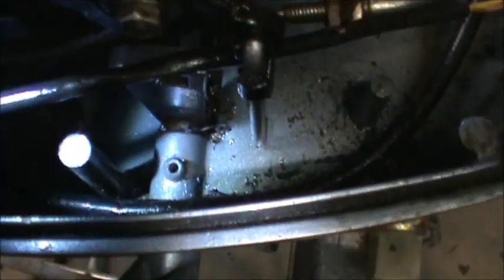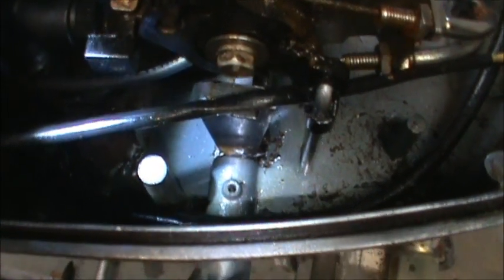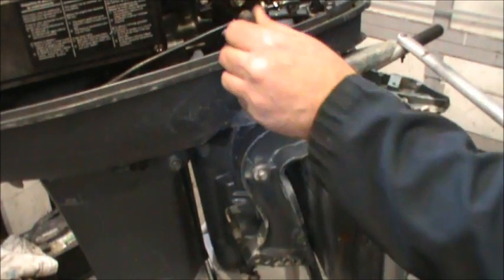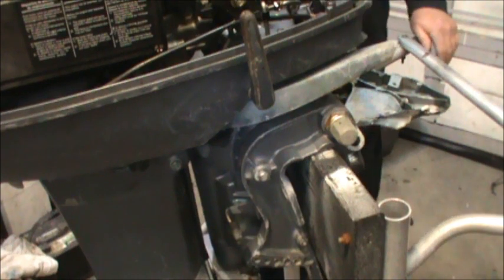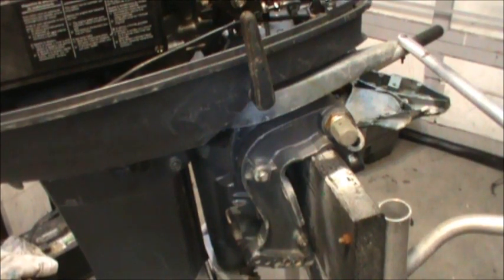You can see there's an oil zert there. I drilled that out as best I could and shot some fluid in there. I don't think I can heat anything in here because I do believe the shift handle is plastic. So I'm going to have to probably drill a couple pilot holes, get some more lube in there, and then get a hammer on this flat square stock and try to drive it toward the handle. Let me get set up and I'll see what I can do.